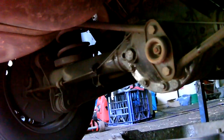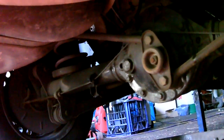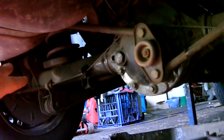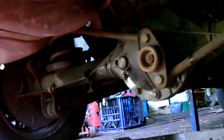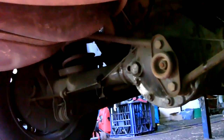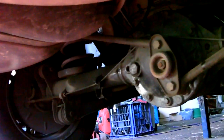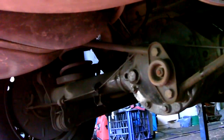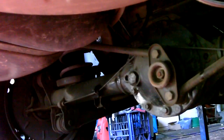This is what it looks like under the rear end of a 1998 EL Falcon. It's a live axle rear with watts linkage and coil spring. The diff itself is called a Borg Warner 78 series, which is quite a strong diff. Plenty of these in Australian cars — they came out in Fords, Holdens, Valiants and all sorts of things.